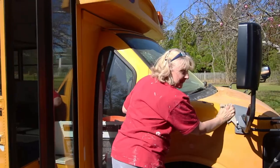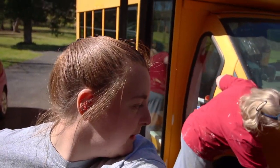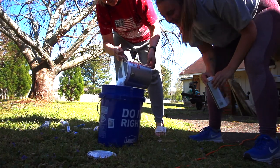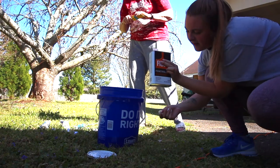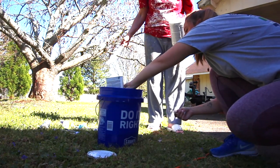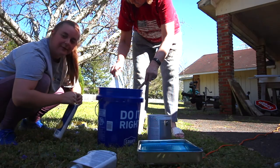This is my mom — she's helping me with the paint job on the bus. It's been sanded, so we did one coat of just wiping off the dust, and now we're going in with just some Dawn dish soap and water. We're using a white Rust-Oleum as the primer, so this is not the final paint color. And then we've got this paint thinner to help everything go on smoothly. Give it a stir, mama. This is an oil-based paint that is meant to prevent rust, so it's perfect for this primer.